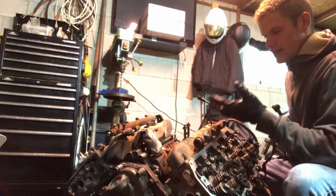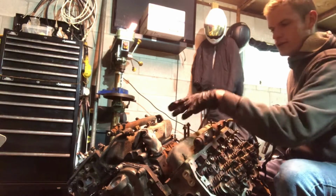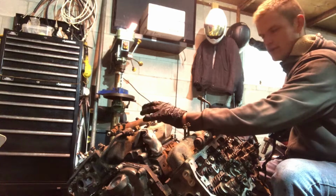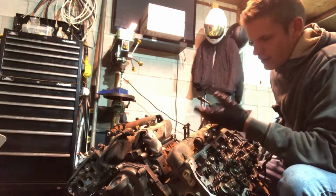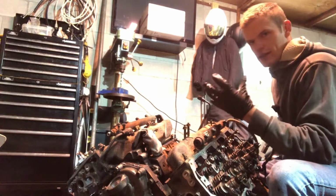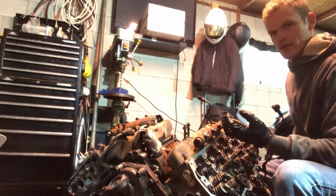Also, if the engine has emissions, these air intakes here, it gets the exhaust recirculated and goes back into these air intakes in the manifold. Any diesel engine with emissions on it, it will go into the manifold and then it'll create this tar substance and coat it entirely. So when that's cleaned out, the throttle response is much crisper and feels a lot better and way more responsive.